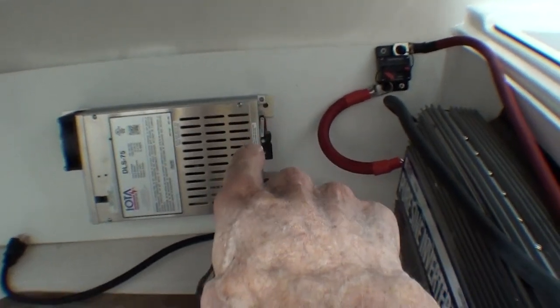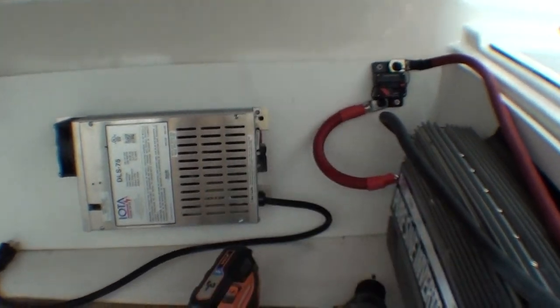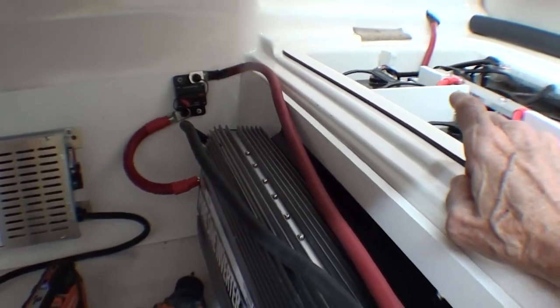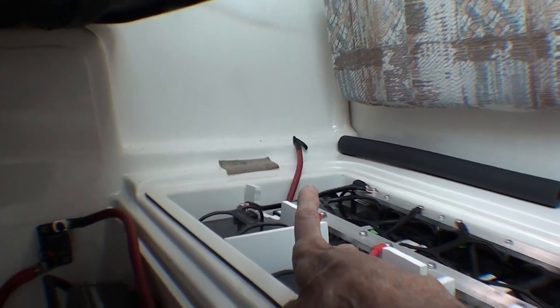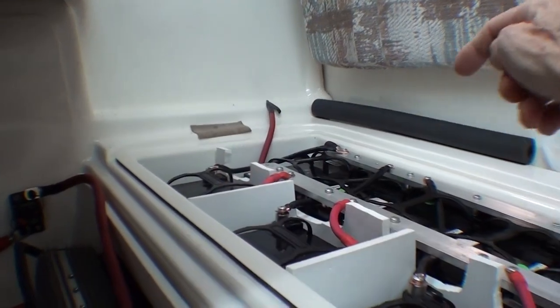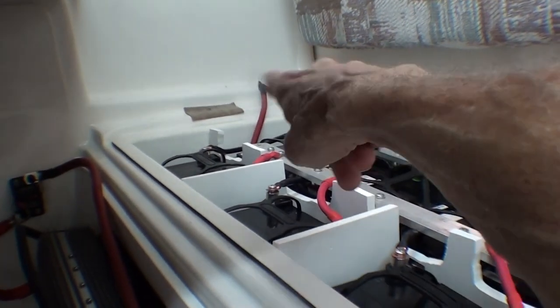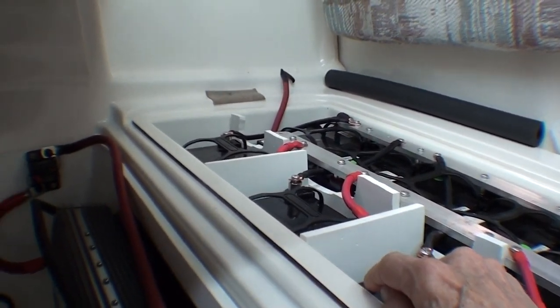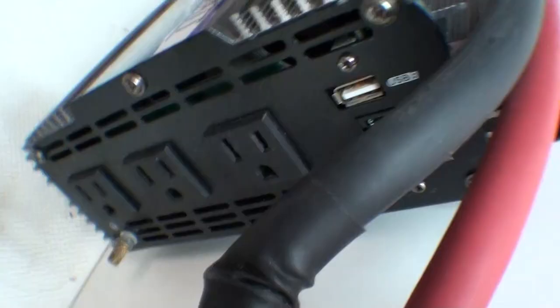I'm going to make a short cable for the positive side that just goes over a little bit to where the breaker can be, and then a cable from there to the battery, and the ground cable to the battery. And at that point I can connect everything. I've still got that one cable that's the positive from all the batteries below these batteries. So I'll have to check the voltage on that and on these bus bars, and if they're close enough, within a few tenths of a volt, I can connect them. And that's it. Then I plug something in and see if I can work it.